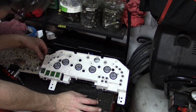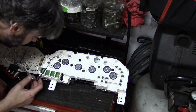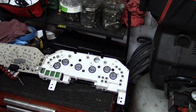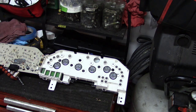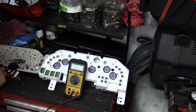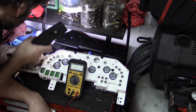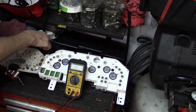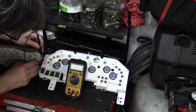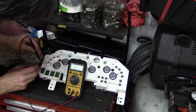I wonder if we have to replace those resistors. I'm not an electronics person, but let me test them — it says 60 ohm. Let's test those resistors real quick to see if we have to replace them. It is 60 ohm — just a little bit hard to read. So let's just make sure. Okay, I can't read them because it's all faded and scratched out, but I'm going to see if these all read the same, and it looks like they do.